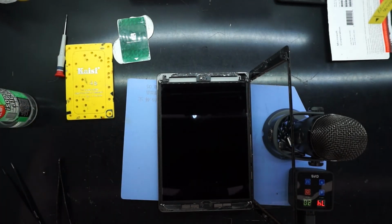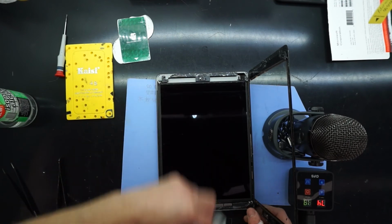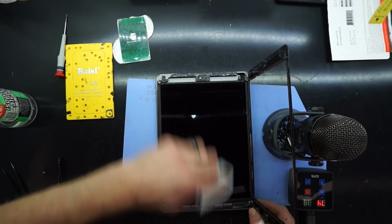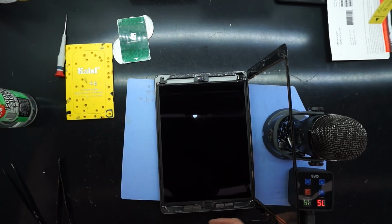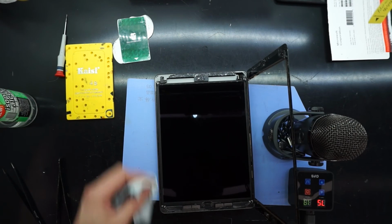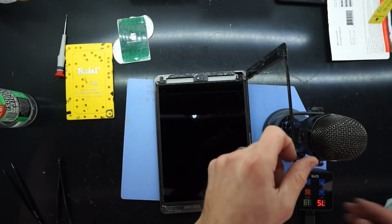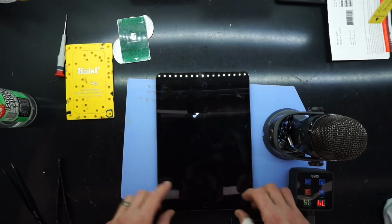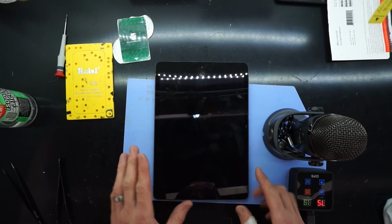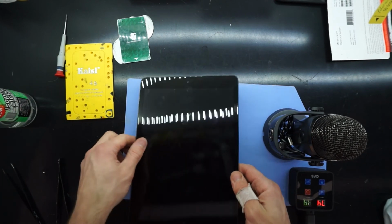Then from there you want to give your screen a quick clean if it did get dirty in that process, which typically it will, but at least you can clean the screen with a microfiber cloth. Trying to clean the touch panel on the inside, it usually drives you a bit mad. So hopefully you can have dirt and grime only on the display. Then from there, you should be able to, a bit of fluff there, lay your existing display touch panel down, and you can either freshly tape it back down, but usually if you haven't fully cleared the adhesive, what you could probably do from here is just simply heat it up, put some heavy weights on it, just to push that touch panel back down, and it should hopefully adhere reasonably well from there.